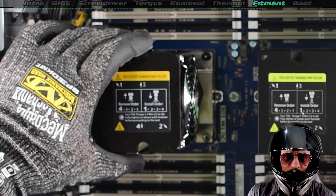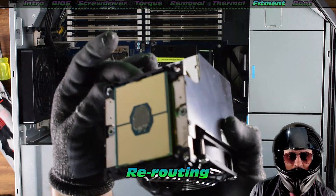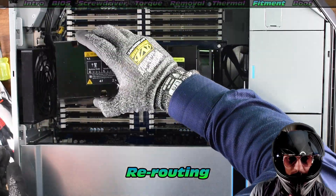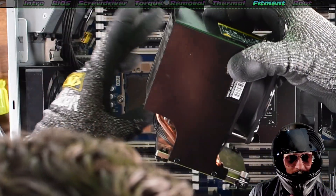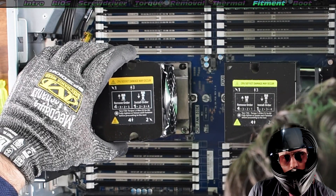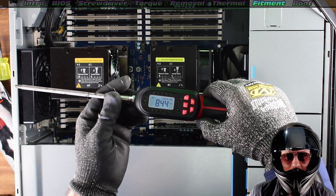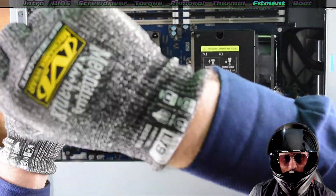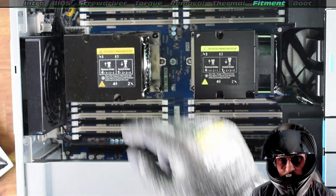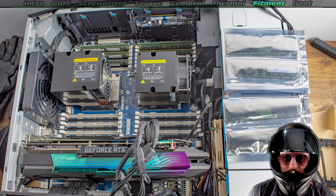Just as I go to install this, I'm keen for a bit of wire rerouting — the cable tension was a bit tight. The fan connection is probably better suited to route on the other side. Once we fit this particular CPU, probably best to first plug it in — learned that from the first one. For that digital torque screwdriver yet again: be very careful. Once we've done our criss-cross pattern — take note, you only do one round the whole way through. Set your torque wrench to 12 inch pounds, the recommended specification. Then we throw our RAM back in and we're ready.